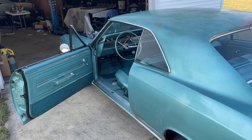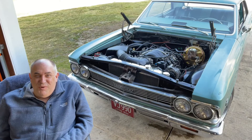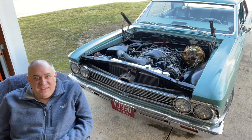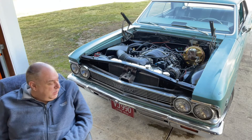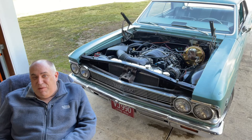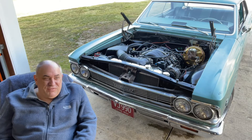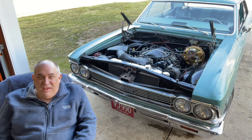All right, that's it. We're gonna shut her down for a while. Well, there you go, Northern Ohio Chevelle Club — the '66 Chevelle with the L99 LS3 version all-aluminum V8 is running. She's a-gurgling because she's just got done with her break-in. I got a little bit of radiator overflow; I think she still needs to burp a little bit, but that's okay. I'm pretty happy. The oil pressure is at 40 to 50 PSI somewhere in there, but I do see it drop a little bit when it goes to idle — not too happy about that, but we'll see.